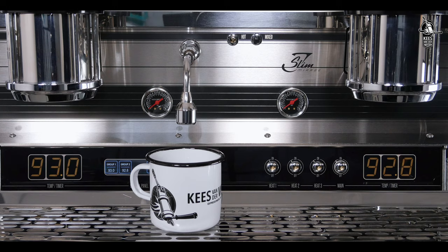Briefly press the mixed water button to start water flow, then press again briefly when the desired amount of water is reached. Note that the controller stores the time between activation and deactivation of the hot water spout rather than the actual volume.